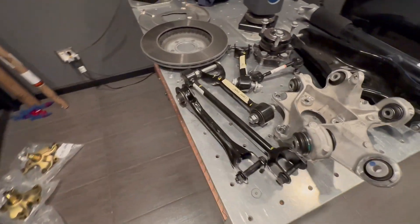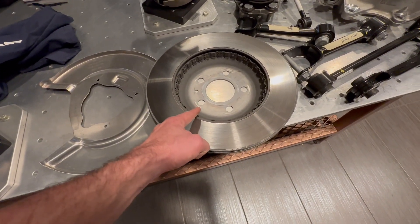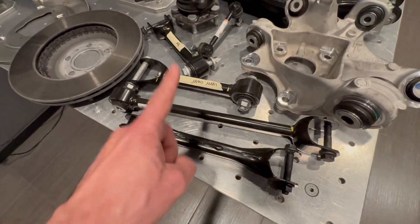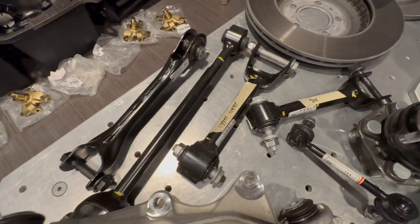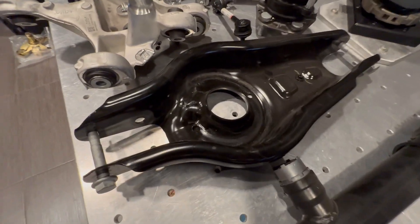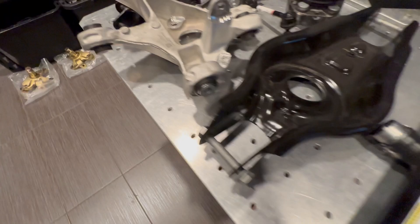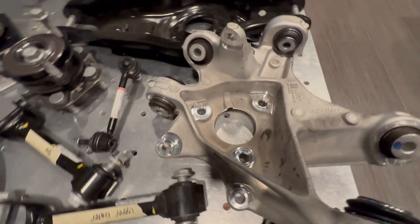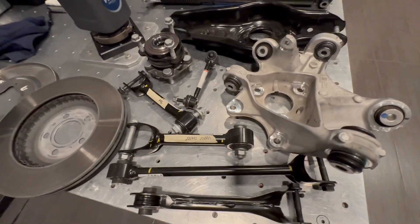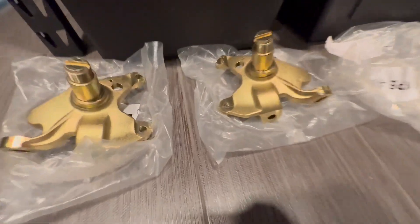Here's the whole collection of parts scored from taking apart the rear end: a super cool two-piece rotor, very light sheet metal center, all these straight arms and rods. The more car parts we make, the luckier we get having the right length adjustable straight arms, sway bar link, hub, and the huge rear lower control arm. My aim is to make a true coilover — not a separated spring and shock — and this nice lightweight rear knuckle will let us know what's happening in the rear suspension geometry when we model it up with the subframe. Oh — forged knuckle!